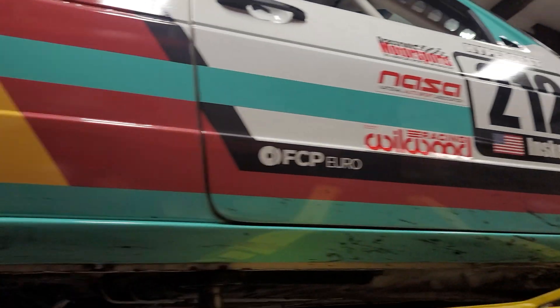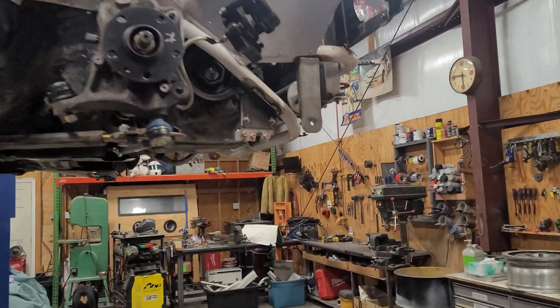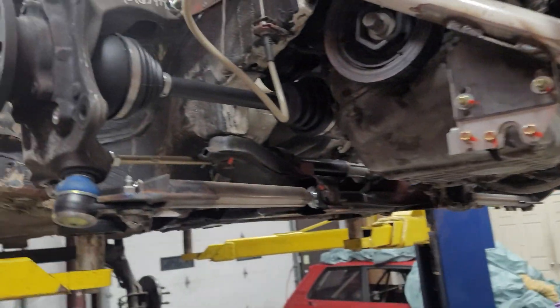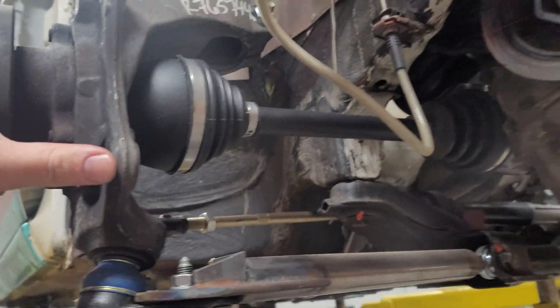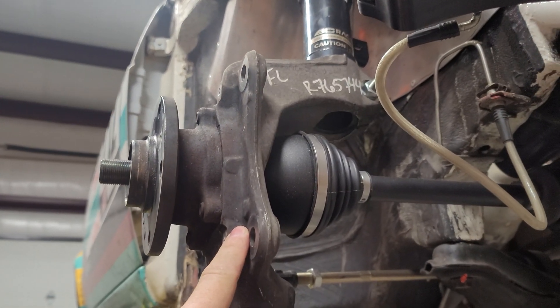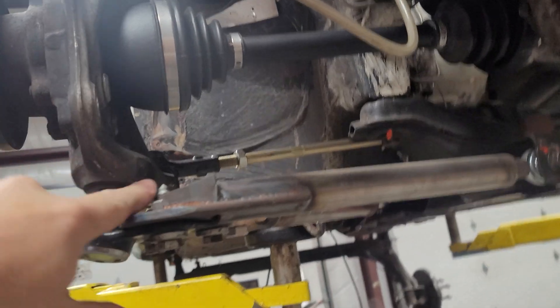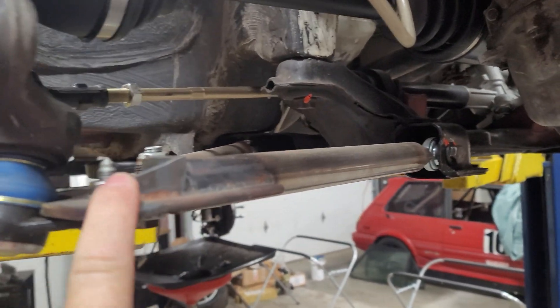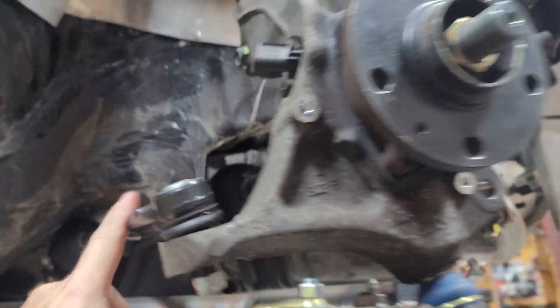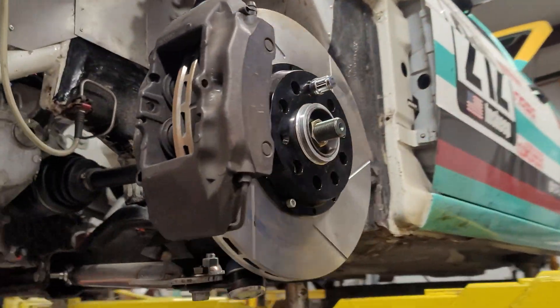It made the car feel a little bit more legit, but I've always still had the same issues with wheel bearings and brakes. So I'm starting the completion of something from two years ago almost now, which is an Audi TT TTS hub — like a 2010, 2011 — which has a different roll center than like a MK7 Golf. And then some custom-made control arms, which is what originally prompted this because we kept breaking these. I've got to figure out something for the steering, but this is 5x112, and the best part is I do get to go with a bigger brake package.